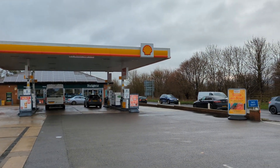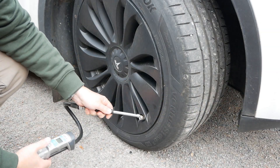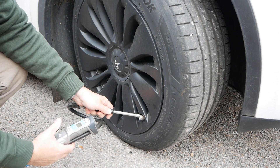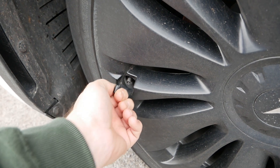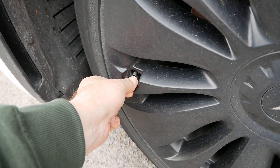If you have to drive to a petrol station to use their tyre inflator, you'll want to pump the tyres up about three to four psi more than the recommended cold pressure, because you're checking them when the tyres are warmed up. Obviously that depends on the distance you've driven and how warm they are, but it's better to over-inflate slightly as it's easier to take some air out at home if needed.